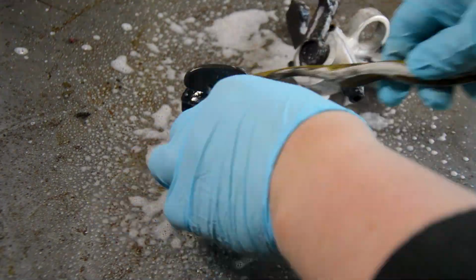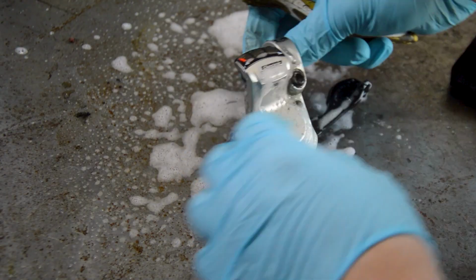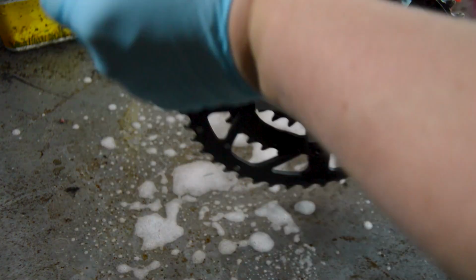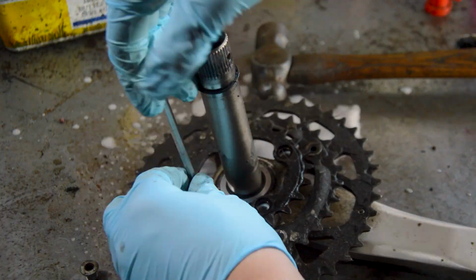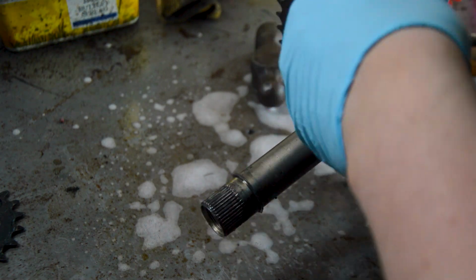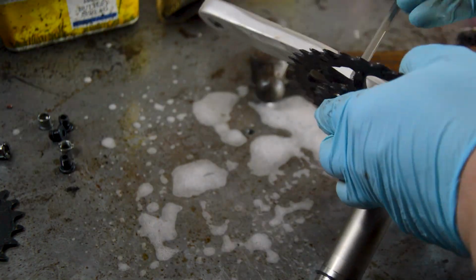And here we are. The bike is stripped down and it's onto the next stage of hiring a squeaking hamster to clean all my parts while I wait for the frame to be done. Rather than mess about with paints during the winter, I decided to take the frame, fork and stem to a local powder coating shop to get everything Cerakoted. For those that don't know, Cerakote is a process similar to powder coating, but it goes on a lot thinner. I believe it's a bit more durable. Parts don't have to get as hot when they're baked on, and it just looks so much better.